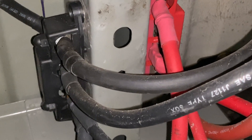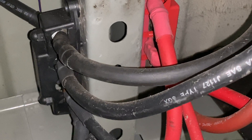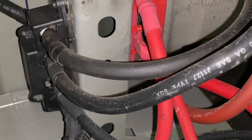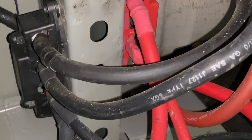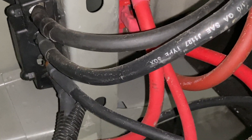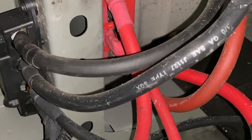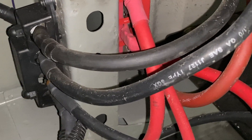If you see these blocks over here — the red one and the black one — those are the first upgrades I did on this unit when I got it. All of the red wires before were connected to the AGM battery terminals. I separated all of them: red goes to the red bus bar, black to the negative bus bar. Now I only have one wire going inside the camper van connected to the positive side of the lithium batteries, same with the negative.